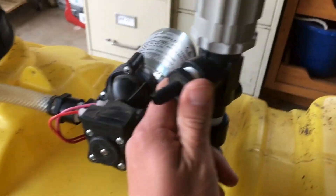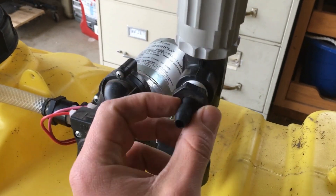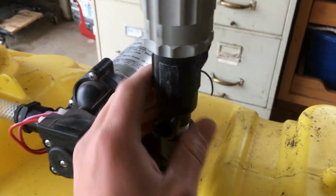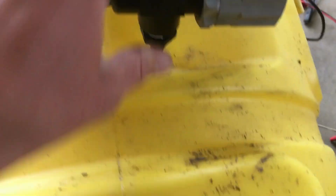The regulating valve goes into the T. Note the inlet and outlet on the bypass valve. The port with the hose barb is the relief outlet of the regulating valve — this is what we want returning to the tank. There is no seal around this barb in the tank wall, yet I've encountered no issues with liquid spurting out when driving.